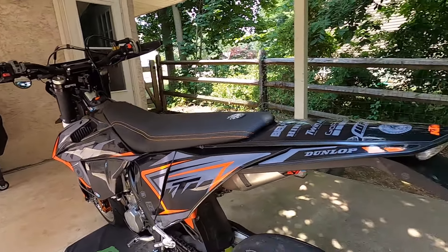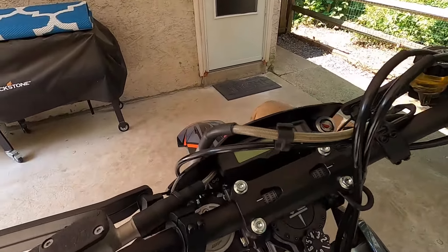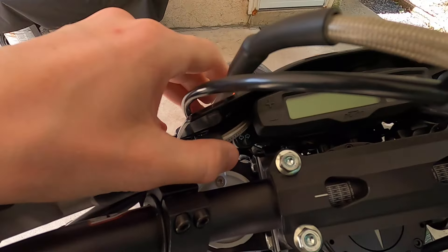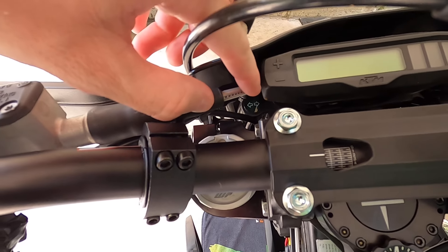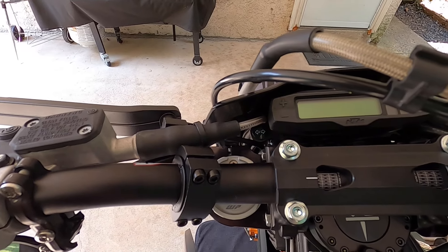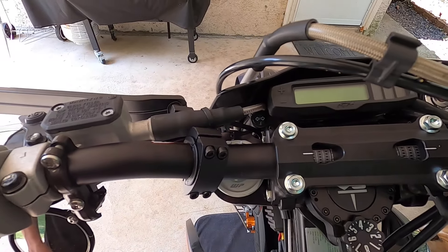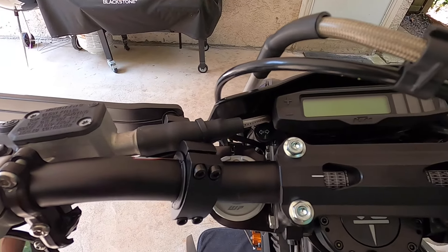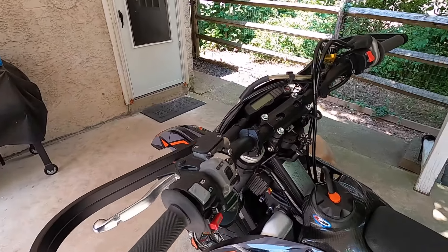When you go with LED lights front and back, you have a turn signal indicator up here showing you when your turn signals are on - the little green one. I think it's an incandescent bulb and you've got to change that over to LED as well. But things like the flasher relays and the dongle are very cheap parts, so you've got to hook it all up to make it work properly.